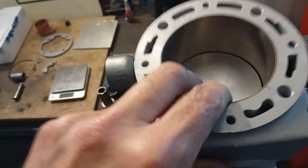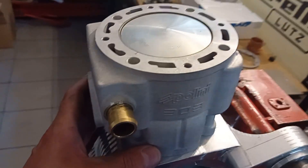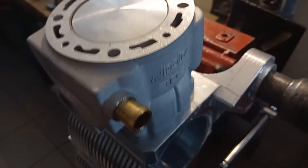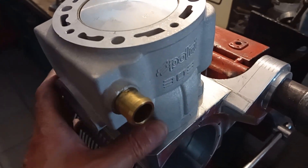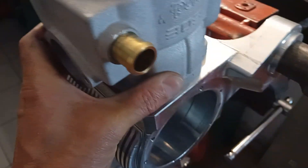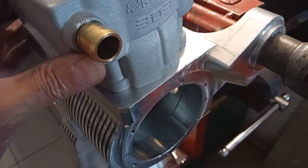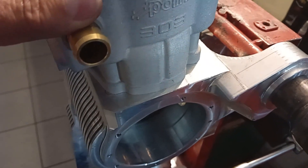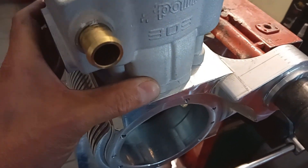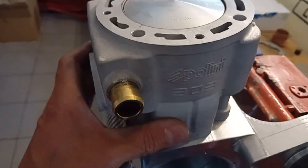You see, at first it doesn't look so bad — it looks like, with a little bit of machining, it could work. That machining would also give the possibility of centralizing, because the diameter of the bottom of the cylinder is not the same as the bore of the case — there's a 0.8mm difference. You'd have to machine a little to centralize the barrel, but on the top it would be almost perfect.